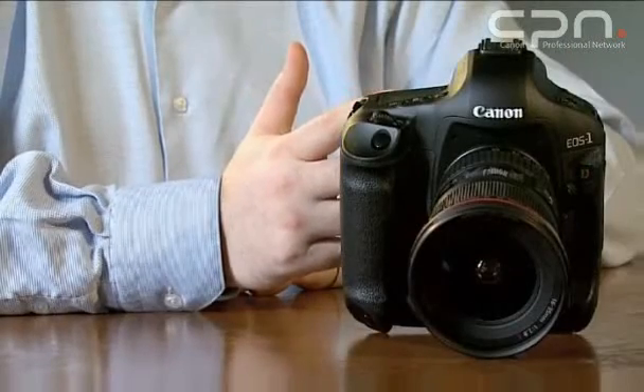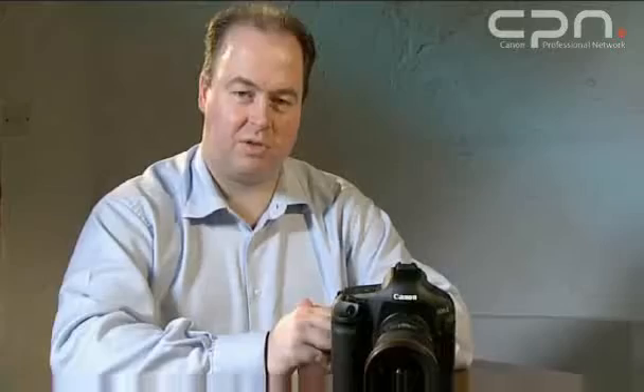The camera features Canon's dual Digic 3 processors — that's two processors working in parallel to process up to a hundred megapixels of data in a single second. What that means is a super responsive camera that's able to take an image, process it, put it back in the buffer even before the next picture is taken, even when running at 10 frames per second.